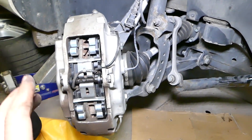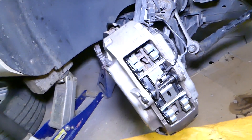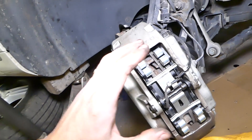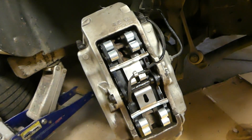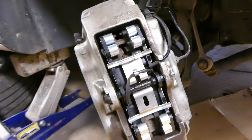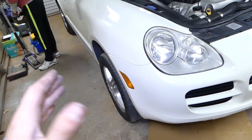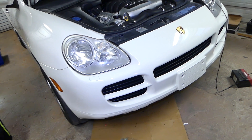Something very important: one person needs to go inside the car — do not start it yet — and press the brake pedal hard as much as you can, probably 20 times or even more, until you feel the brake pedal really hard all the way up. We now have play in the calipers, and if you hit the brakes a few times without doing this you're not going to have brakes at first. You can see now it's contacting. Get the wheel tight — check our channel for the wheel torque specs video. That's how we replace the brake pads on our Cayenne. Hopefully this was helpful — please hit that subscribe button for more videos.